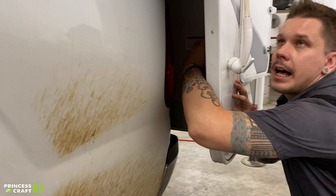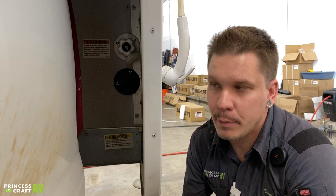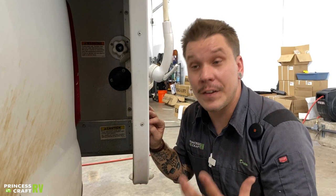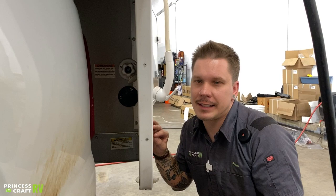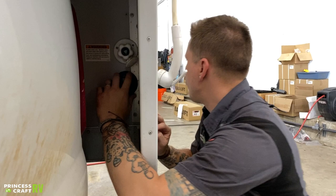Underneath this wing we have some water inlets. The first one is your city water connection. Water pressure becomes very important here — we want to keep that water pressure between 40 and 75 PSI. With your purchase it includes a water pressure regulator that regulates between 40 and 50 PSI. The unit's working water pressure is between 40 and 75 PSI, so feel free to upgrade the regulator as long as you're not exceeding that 75 PSI limit.